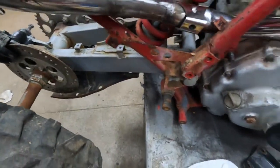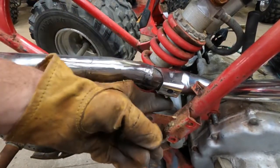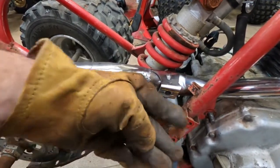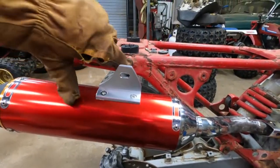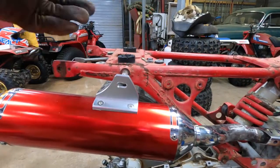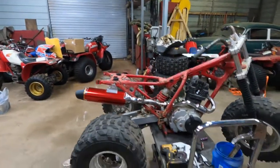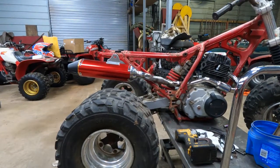A couple things I wanted to pick up for sure. I wanted to pick up this mounting bolt right here. And remember when we started, it was pointing down. Kind of had a weird goofy angle. I wanted it straight so I could come out of here with a tab, either come across or come up or something. But I wanted to pick up on that support. And then of course I wanted to try as best I could and hit the factory mark. I can weld a bolt on here and bring it through a stud or a nut or, you know, any combination there. But I hit the factory pickup point and it's lower now and it's straight. So it will clear the rear fender.